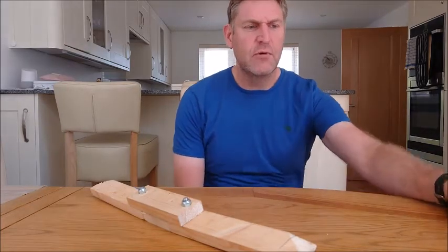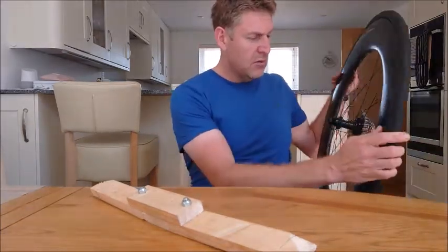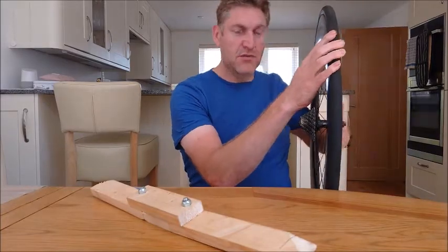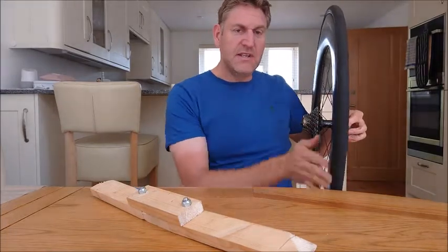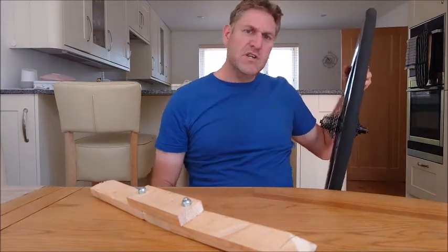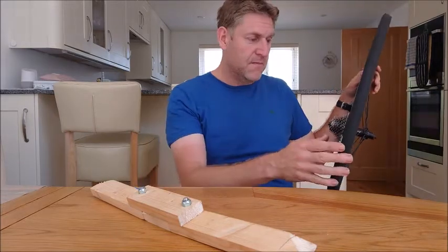But first I need to work out exactly what I'm trying to make, dimensionally that is. So just to recap, I've got my wheel here. I want to cover both sides, but the drive side with the cassette has got a shallower dish than the non-drive side. This is because where the tyre needs to run central to the frame, the cassette gets in the way so they make a shallower dish. I need some way to accurately measure how much dish I need for each side before I can make the mould and then lay the carbon fibre down on it.